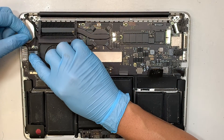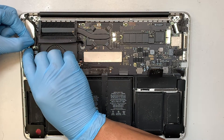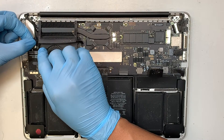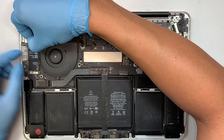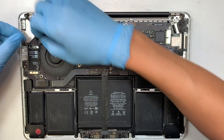Here comes your Wi-Fi antenna cable. Make sure you have it in the right position — that little circle needs to be aligned on top of each other. When you press it down it shouldn't be hard; you shouldn't force it. It should be very easy once you have them aligned, and when you press it, it should just go back in.